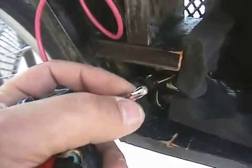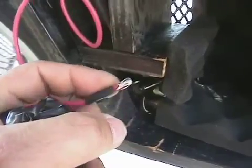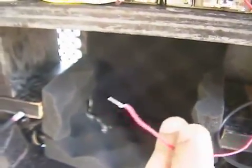I padded the inside of the battery box. I use a really heavy gauge wire for the battery. They don't have a connector, so I basically just folded the wire over and coated it with some solder to make a plug. For now it works. I got the extra lead here that I tap into the balancing lead on the packs to fool the controller into 48 volts. That works good.